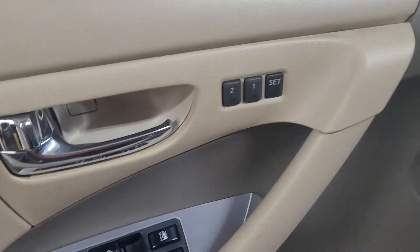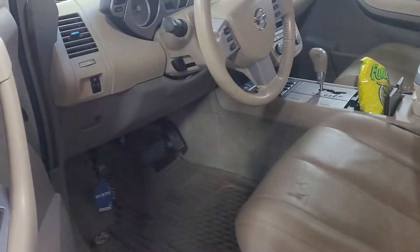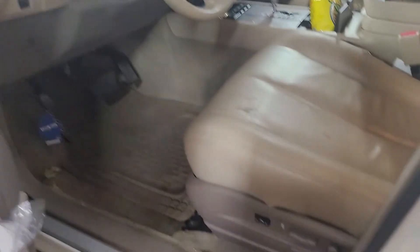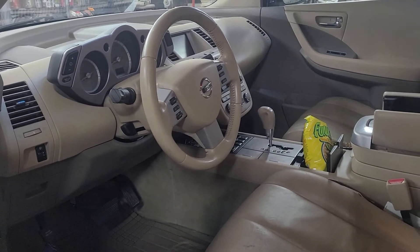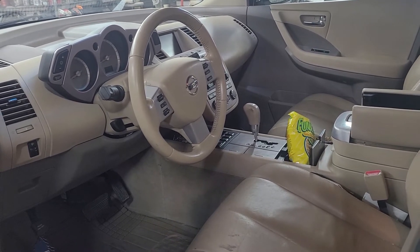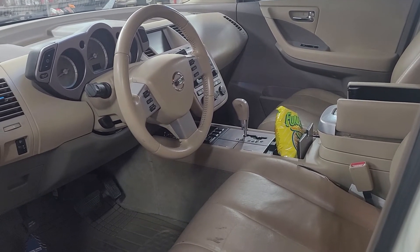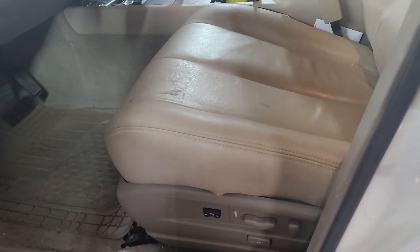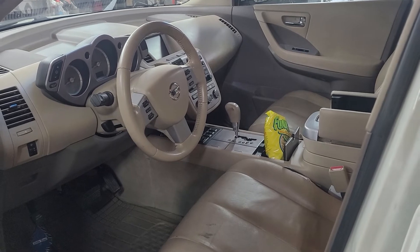Check your switch — you can reach up in there and feel the motor to see if it's hot. If the motor is hot after the car has been parked for an hour or so, that's exactly what it is. There was a clicking noise about every 30 to 45 seconds you could hear after you shut the car off. Open and close the driver's door but stay seated, and if you hear that clicking up under the dash make sure you check your switch, because this one does stick in the back direction and that's what was killing the battery over two days of being parked.